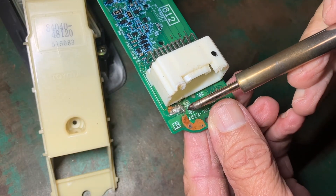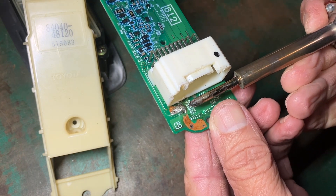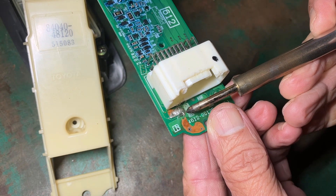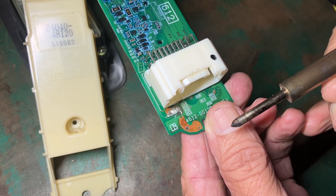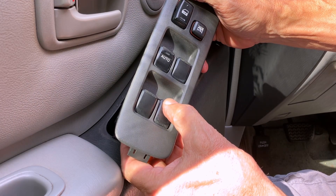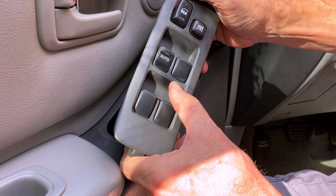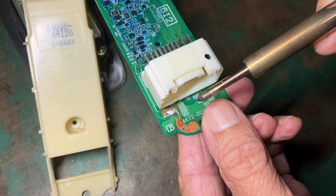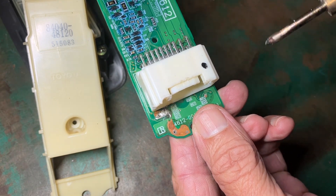What you're looking at is a failed attempt to re-solder that joint. I shouldn't have even attempted it with this soldering iron — I needed a micro tip, and I should have bought a new kit, but I did not. I attempted this, plugged it back in, and here's what happened: the window goes down, but still does not come back up. With that failed attempt, and thinking I had damaged this control board beyond repair, I went to Plan B.